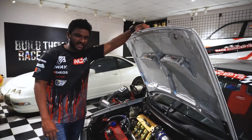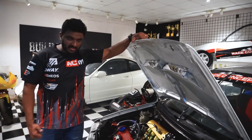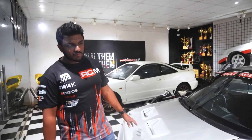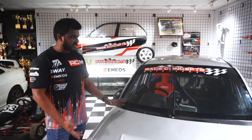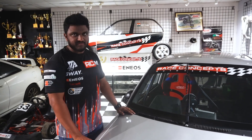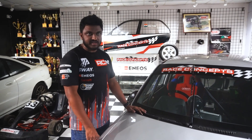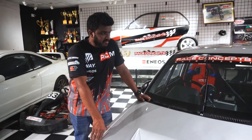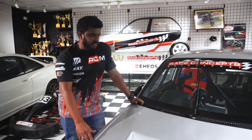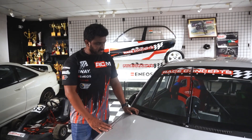The original car does about 6,500 RPM — up by almost 2,000 RPM. It doesn't show any strain; it wants to rev all day. Quite strong torque all the way from 3,500–4,000 RPM all the way to the redline — so I have a ball driving it. In terms of weight, the car is quite heavy. Ideally I want the car to be sub-800kg, but it isn't, because the car has put on a lot of weight with the roll cage and extra bits. It is about 825 kilos with me in it. The car's dry weight is roughly close to stock — around 730kg, a few kilos lighter.